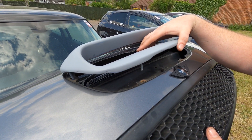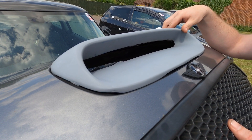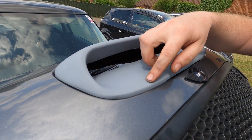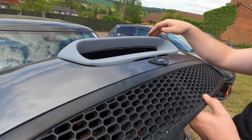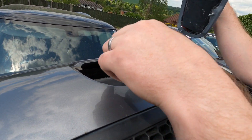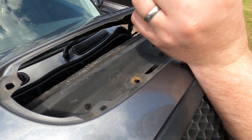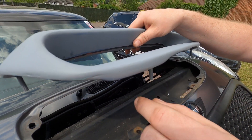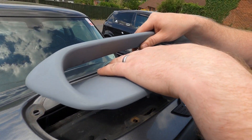We're just test fitting it now, putting all the studs down through into the holes. You can see there is a gap on the sides and it's not quite fitting straight. What they tell you to do is look at the holes where the bolts go through and see where the stud is catching. You need to drill out that hole a little bit more in the angle where it's catching - if it's catching on this side, drill to the left of the hole just to widen it out a little bit so it fits flush.